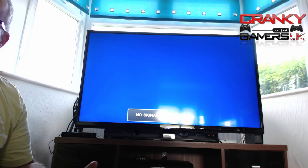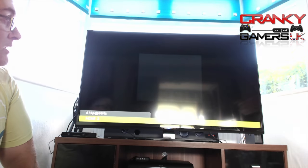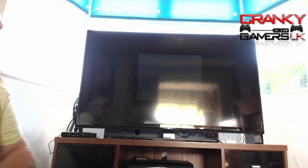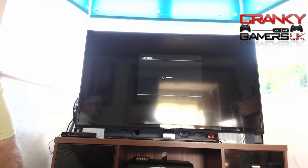Fingers crossed — we're pressing and holding the power button for seven seconds until we hear the second beep, which puts it into safe mode. We let go, connect the wired controller, and we're in safe mode. You go to option number seven at the bottom: Initialize PS4, Reinstall System Software. You have the USB stick in, formatted correctly. We go connect to USB — and we'll see it live right now. Hopefully it's going to find it and all should be good.